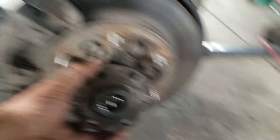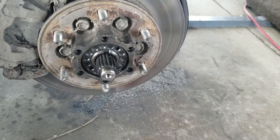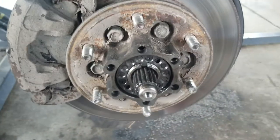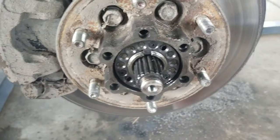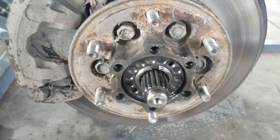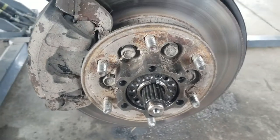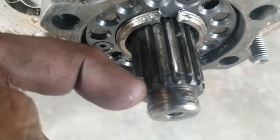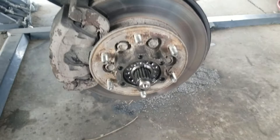So I took off this cap — again that was the eight millimeter hex head. Under here you've got what locks the hub onto the shaft. Basically don't have to touch any of it. I'm going to shift over and unpack the manual locking stuff. You don't reuse any of that, with the exception of maybe the circlip if you didn't get one with the manual locking hub. My auto locking hub had the 26 millimeter circlip — I just removed it from the outer right there and it's going to go right back in that spot.